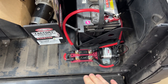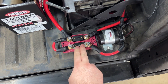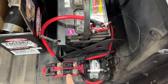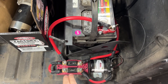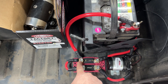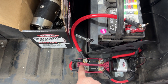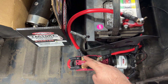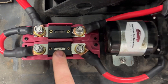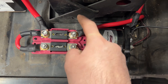So this is how we actually have our drag truck wired up — this is the off season so just ignore some of the boxes. As you can see, we have some ANL mega fuses here — these are mega sized ANL size. The negative side of the battery is disconnected. We have a one gauge cable coming down here, and then from here we have a jumper — we have battery power coming to these two terminals right here. Now we have these fused.